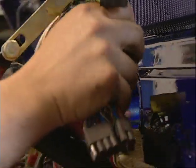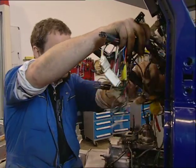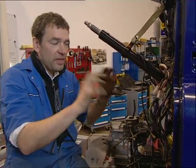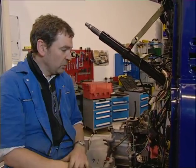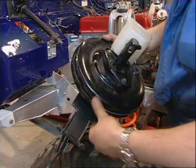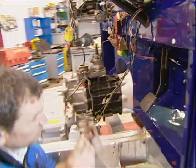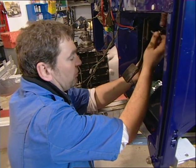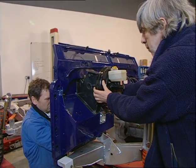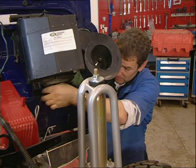That's pretty much it for now because we've got to put all the bits the wiring loom attaches to first. There's a huge temptation to clean this wiring loom off the vehicle with electrical cleaner, but that's a bit of a mistake because you might inadvertently unplug something and not know where it goes back to — it's better to get it all in place and then clean it afterwards. A couple of plates to go on the other side of the bulkhead where those wires go through. Another big bit to go on: brake pedal servo, master cylinder for the brakes, and its little reservoir. A little tip: when cleaning it up, don't press on the brake pedal because you could spray brake fluid in your eye.